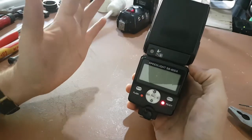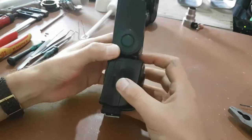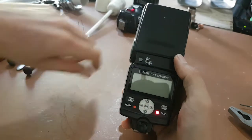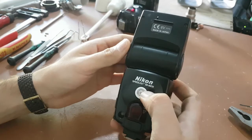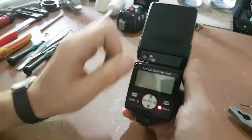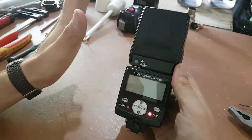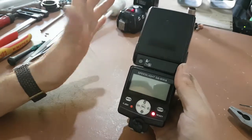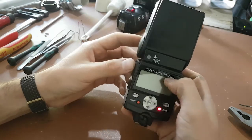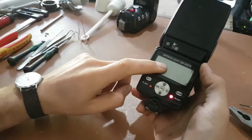By the way, I will take apart the bottom part of the flash. It's almost always the same for most flashes — the way they are assembled is pretty much the same as how you disassemble them. This particular flash is a Nikon SB-80DX, and it is very similar to the Nikon SB-800 — they are 99.9% the same flash, except this one cannot do TTL with newer cameras, while the SB-800 can.